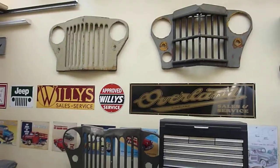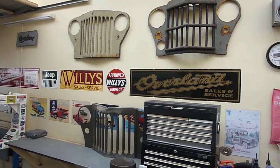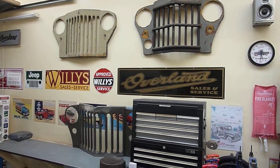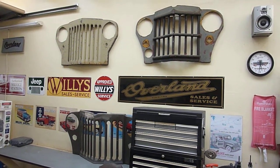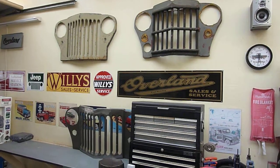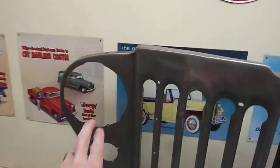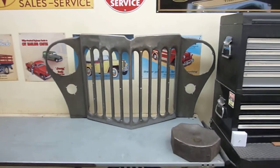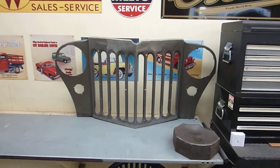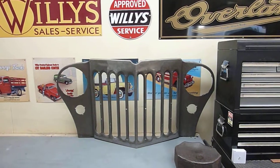You can see there are 10 slots there. This is the '58 grille and there are only 8 slots. So I've come up with something in between the two — the 10 slots from the earlier model and the grille spacing and the V from the later model. I still have to add an extra couple of inches each side to gain the full width of nine inches that the truck is wider than stock, and that will give it a bit more balance at the same time.